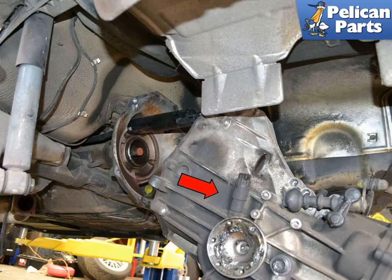Place a small piece of wood between the torque tube and the torsion bar tube to keep the torque tube level while removing the transaxle. Lift the transmission enough to take the weight off the mount and slide the two 13mm bolts out from the top. Then remove the four bolts joining the bell housing to the transaxle. You will need to lower the rear of the transaxle and slide it back — the most difficult part of the job is clearing the shift shaft tube from the transmission. Once this is clear, you can remove the transaxle from the vehicle.